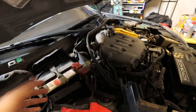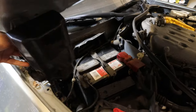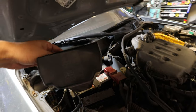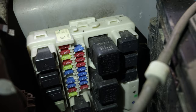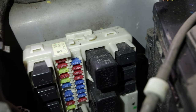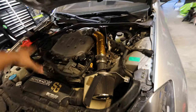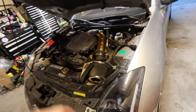The things you're going to need to take off are this cover right here, the cowl that goes on the windshield, and then the cover located down there. Once you remove that, it will tell you where the fuse is for the fuel pump. The fuses will be exposed and the one you're looking for is the first 15-amp fuse in the top right — that's going to be your fuel pump fuse. Disconnect that fuse, then go inside the car and turn it on. If it turns on, it'll turn off in a couple seconds. If it doesn't turn on, just go ahead and crank it. We just saw the car didn't turn over, so we're all good to go.